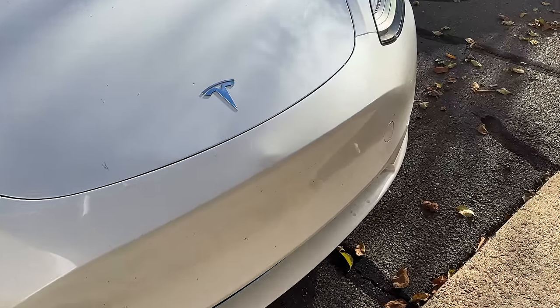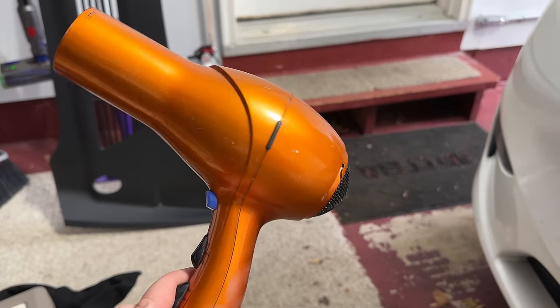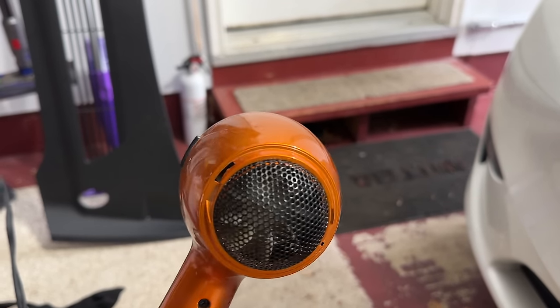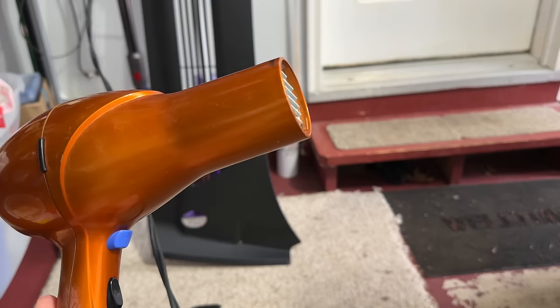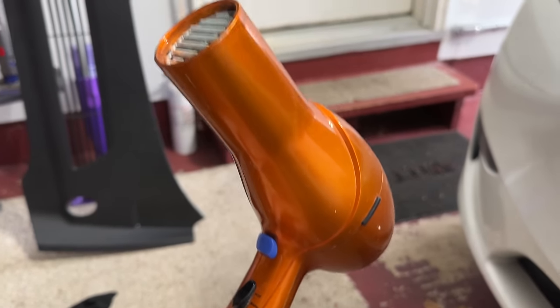I put the tub back in because I do not want to take off this bumper. So what I'm going to do is put the heat right on the top. It's kind of pushed up right over here a little bit, and I'm thinking if I can get that a little bit warm — not too hot — I may be able to just push it down and hopefully this will just come right out and be back to normal. It's a tiny, tiny, tiny little indentation. Maybe you can't even see it. My weapon of choice is a hairdryer. I don't have a heat gun, but this is in effect a heat gun — maybe not as hot. We're going to heat up this spot right here and hopefully get it back.